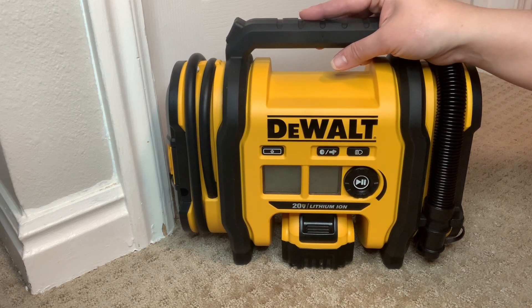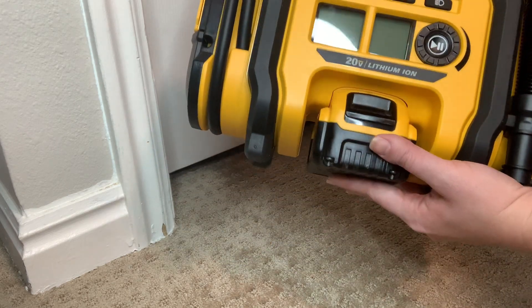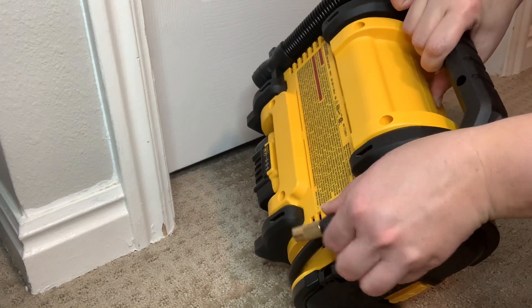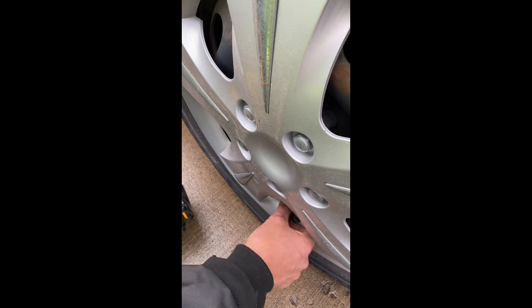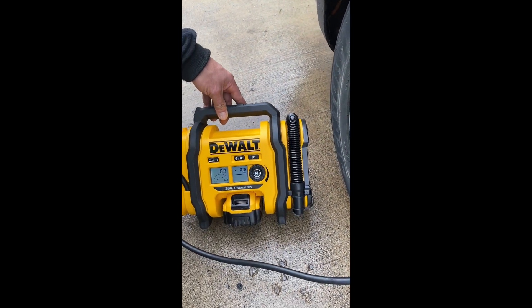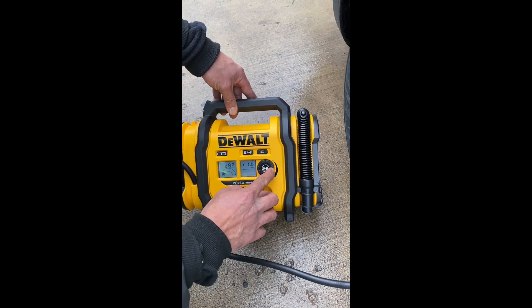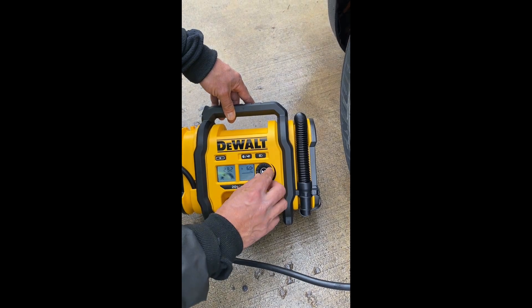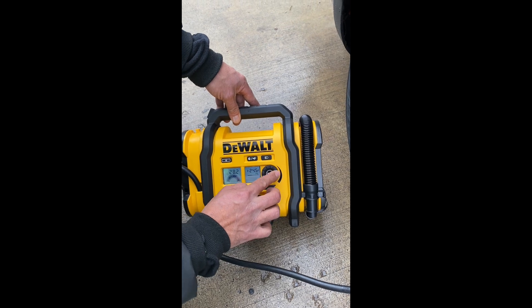This inflator is very easy to use, even for someone who isn't familiar with using an air compressor or tire inflators. You will first need to connect the inflator to a power source. In this case, I have my battery pack right here. And you'll also go in the back here and pull this out and connect this to your tire. Make sure it's secured on there. And then when you turn the power on, on the left side, it will show you the current PSI on your tire. And then for the right side, you can spin that little wheel there and put it where you want it to be for your specific tire.